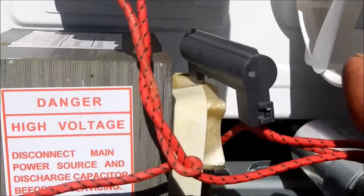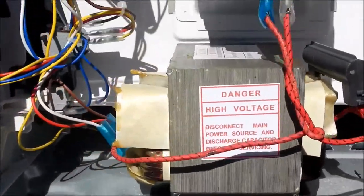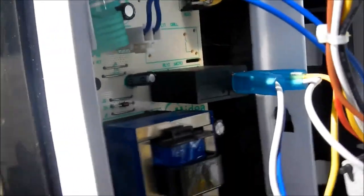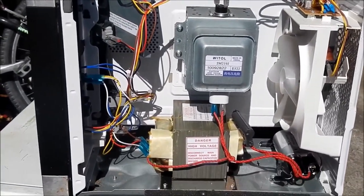Fuse there, clipped straight onto the transformer this time. Another microwave transformer about the same size, another magnetron, another light globe, switches - all the same sort of setup. Only one relay on the board this time because there's no convection. I'll get these parts out and on to the next microwave.